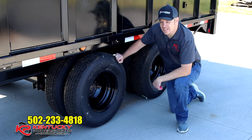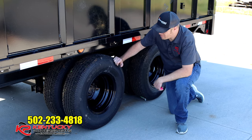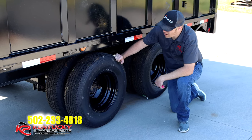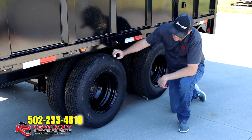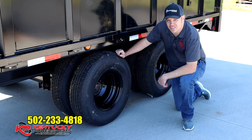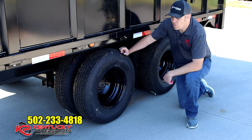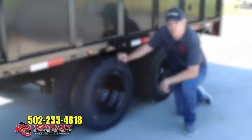As with all PJs, they come standard with Dexter axles. Dexter axles are the best axles in the business. With this being a dual-wheel model, it has the dual-wheel side-by-side setup. It comes with 235-80 R16 tires — a good setup that you will get a lot of mileage out of. This axle also comes standard with a five-year warranty.